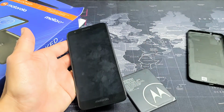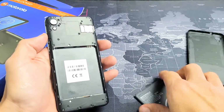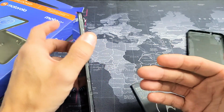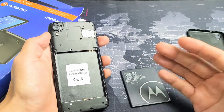If you still have the black screen, then I want you to do the same thing again. Pull the battery out, press and hold that power button for 30 seconds. After 30 seconds, let go, put the battery back in, and then see if there's no more black screen. Now, if it's still not working, try this simple step 5 or 6 more times. Usually the third time it works.